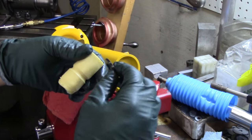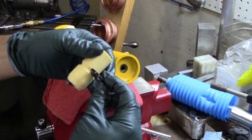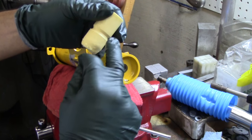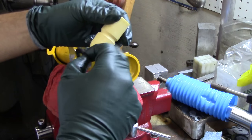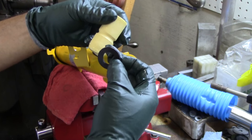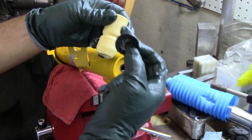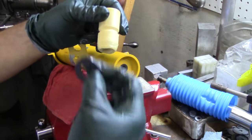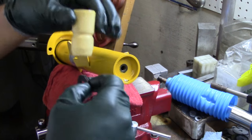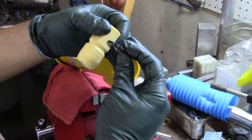We have definitely found improvements with suspension travel. I did this with the front of the BMW struts the same way using Bilstein struts in the Beamer as well — struts and shocks in the rear — with bump stops also internal to the housing. I made my best guess, did some measurements, and said okay it looks like about 25 millimeters. I believe I'm using this density bump stop, but I might actually switch to a 46 white or 46 red instead of what is essentially a white — a 200 pound bump stop. You will also get more understeer using a higher density front bump stop, versus switching to a softer density. So if you go from a Bilstein bump stop to a 46 millimeter, or to a 76 millimeter red or 58 millimeter red and trim those to 25 to 30 millimeters, you're going to get more travel, more linear engagement, and really reduce your understeer. Then use your packers to make sure you've protected the suspension at full compression.